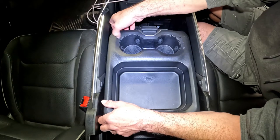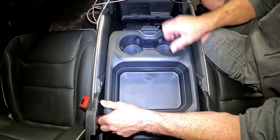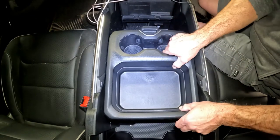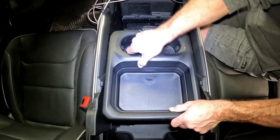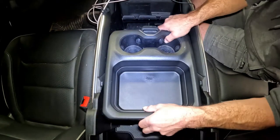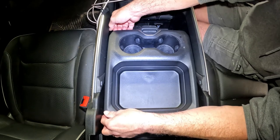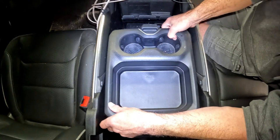You're going to fold your plastic or make a mess. If you can get your fingers or a body tool underneath the front, get them under here and pull up on it. If you can't, grab firmly — and again, this is straight up — pull, and you'll hear the tabs pop. Just go slow. You don't want to break it. Once you get it this far, if you push back on the back a little bit, then you can get your tool, put your fingers under the front, and pop the last couple tabs.